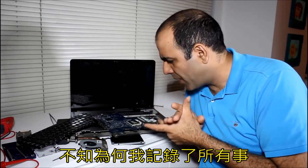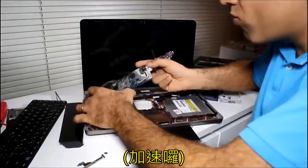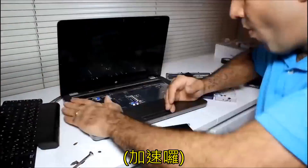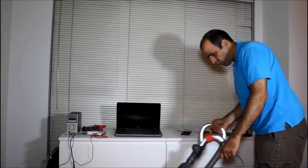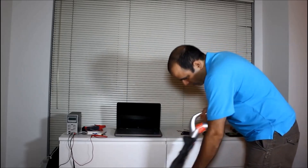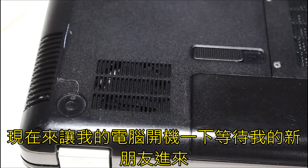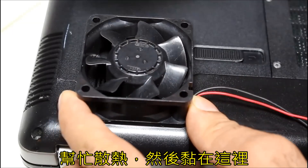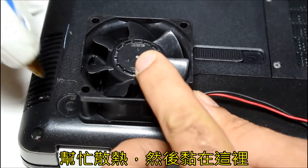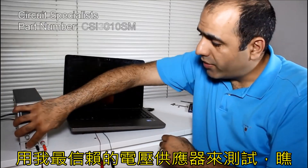I know what to do. I'll first put the laptop together somehow. I recorded everything, so I'll just retrace my steps. And done. There are usually some excess screws that you can vacuum. Now, to make my laptop work while I'm waiting for my new fan to come in, I externally attach a 12 volt fan to it, place it on the intake with the fan blowing towards the laptop, and hot glue it in place. I power it from my trusty power supply.